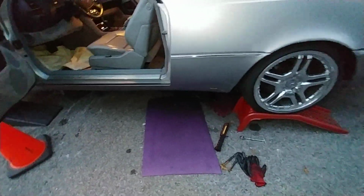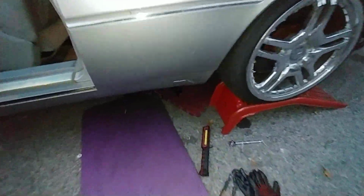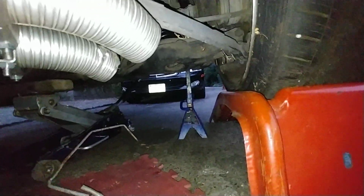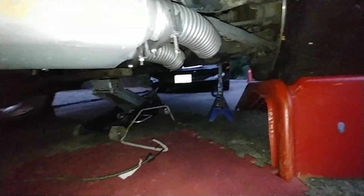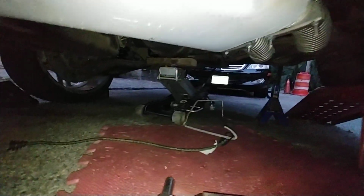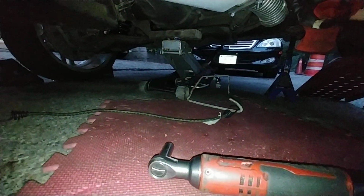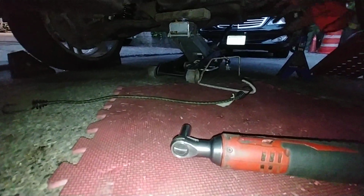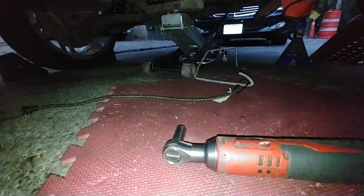I don't know if you remember how it was. There are no leaks before the exhaust, and I already checked it. The way I check it is I basically blocked off both of these, and I don't hear anything out. There's back pressure. I mean, I can't do it while making the video. Let's see if I close it.